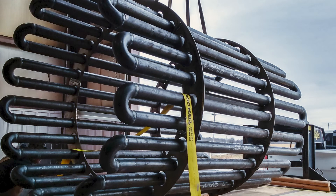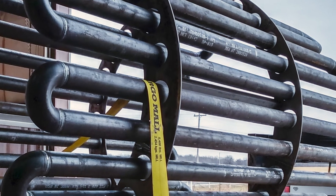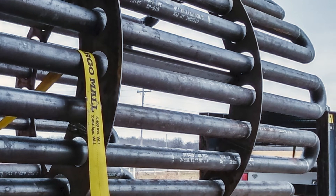You've got a real hot spot along the edge of that pipe, and colder spots on the outside, so it's not as efficient. That's a lot of heat being applied to that one specific spot in the pipe. In the serpentine, because it's winding back and forth and there are gaps between those pipes, the heat can completely wrap around that coil. So you're getting heating on the inside, on the sides, and on the outside of that coil — plus, because it's going back and forth into that hot zone multiple times, it's picking up heat every time before it leaves the heater.